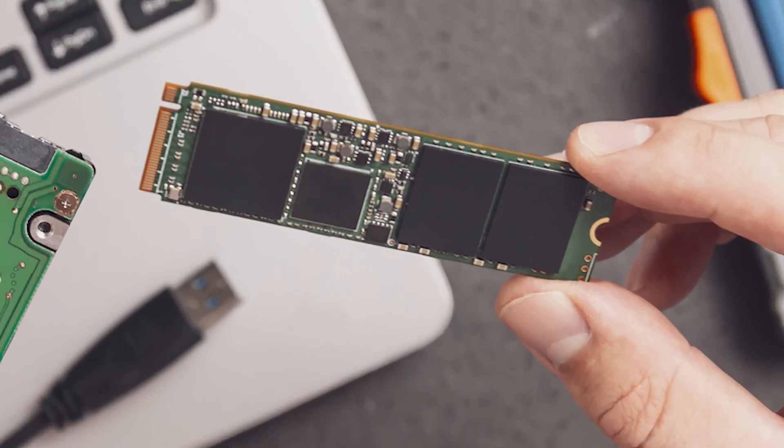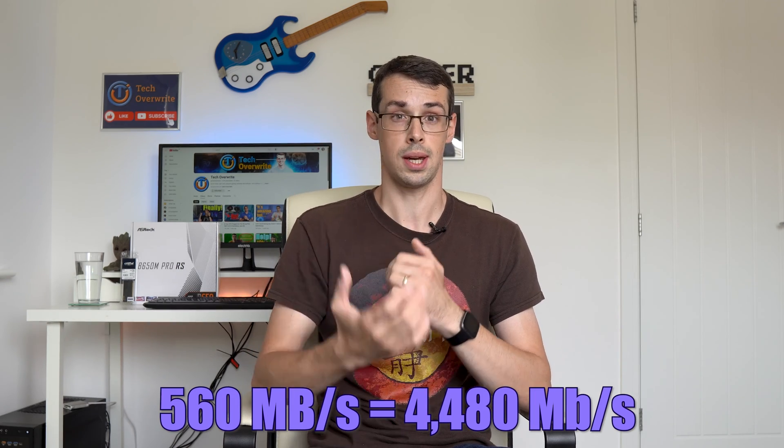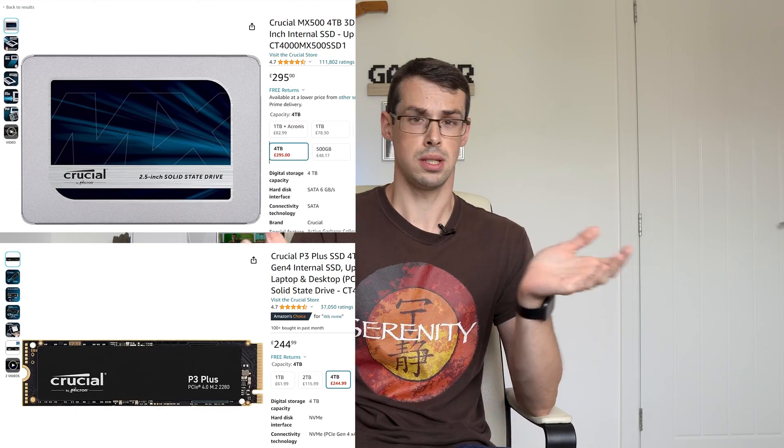This brings me on to why I think the DDR5-based platform like AM5 or LGA 1700 is the best option here. When I say a fast Homelab NAS, I mean one with super fast storage — in other words, M.2 NVMe drives. You could get by with SATA SSDs, and their 500-plus megabyte speeds means you could get close to 5 gigabit per second speeds out of them. But many SATA SSDs actually cost the same as NVMe drives nowadays, and NVMe drives are often 6 to 10 times faster than SATA SSDs.